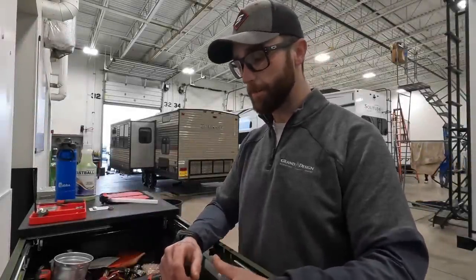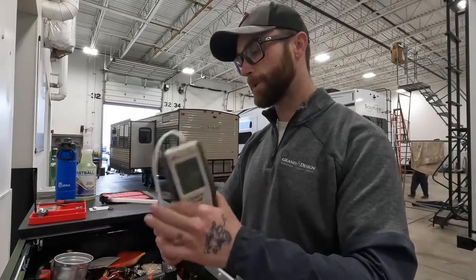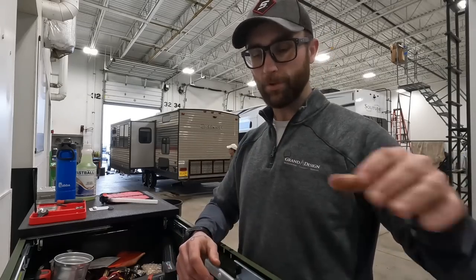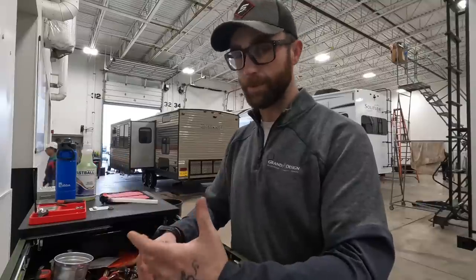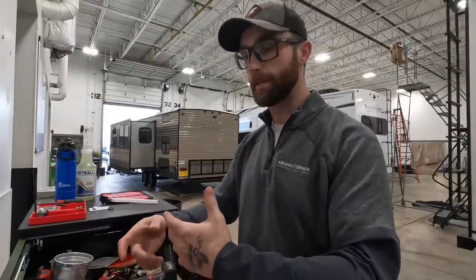This next one is really cheap insurance and it is going to save you money down the road. A lot of you have probably heard of a leak down test — it's essentially testing your propane system for leaks. The way the dealership does it is with a manometer. Purchasing a manometer, you don't need a fancy one — I'm going to show you a cheaper option. Once you know how to do a leak down test in your particular coach, you can do it almost every time you're camping.